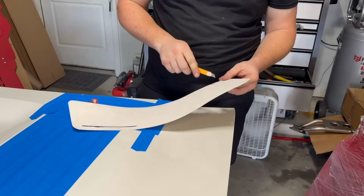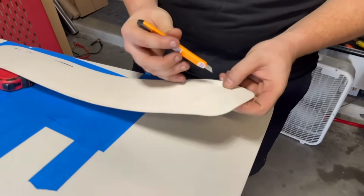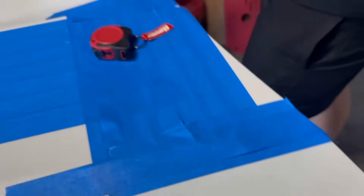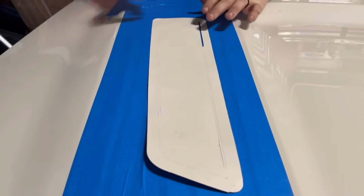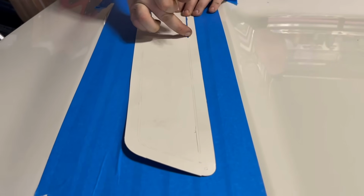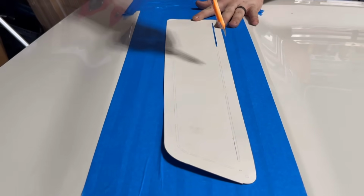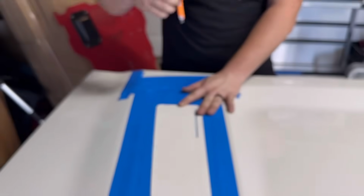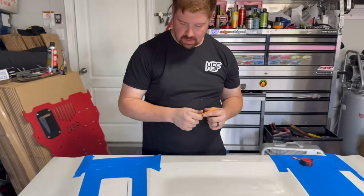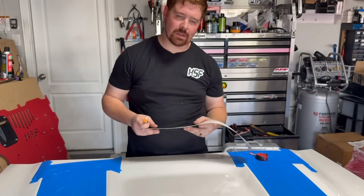They're not all the way stamped through, so having a little knife to help run along the line to cut it, a nice sharp knife, and cut out the template. And then we'll come over here once we measure everything, and we'll end up taping it in place. And then once it's taped in place, all these holes is where you go through, you'll mark it, and that's your section you're going to cut out, plus all the holes that you'll end up drilling, or at least these 2 corner holes to get the hood vent in place. And once the hood vent is in place, we can mark the other holes for the rivets. So a little time consuming, but worth it in the end to make sure that it's where you want it to be.